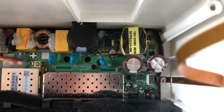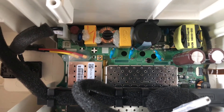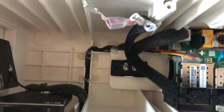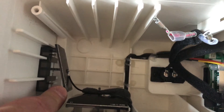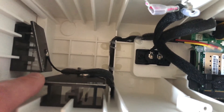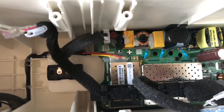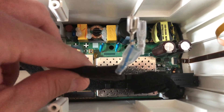Pulling the woofer and tweeter cables off is super easy — just slide them off. This is the important part: this is the Sonos computer, essentially, which handles streaming duties. It's also bi-amplified, so there are two amplifiers and an electronic crossover that feeds a separate signal to the woofer and tweeter. Up here you can see the antennas for Wi-Fi reception. On the right-hand side, you can see where the actual AC power comes in. There's quite a bit of space in the back panel — not jammed packed at all — and it's a pretty simple module, not as big as I've seen on other Sonos speakers.